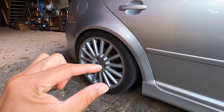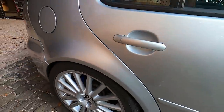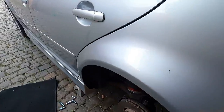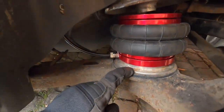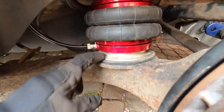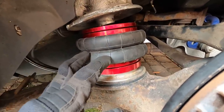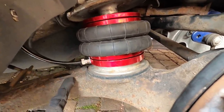There's also a little perch below the bag that held the spring in place. I didn't think it came out, but people said it does, so I'm gonna try it today. We've got the car up in the air — the piece in question is this silver little aluminum piece right there. That's what the spring sits around. I'm gonna pull the bag real quick and then try and pull it out.